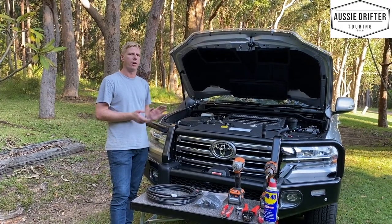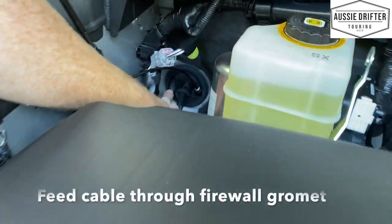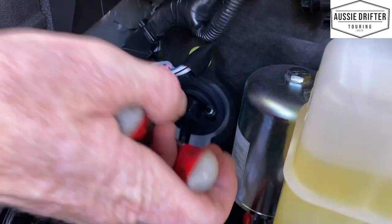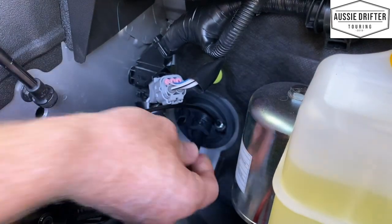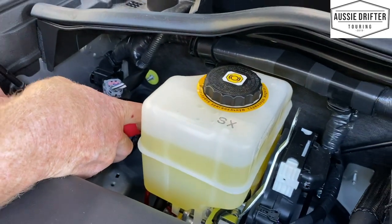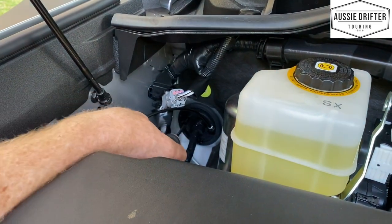We'll show you how to get the trims apart inside and run it all the way to the rear. Our first step requires a little bit of lubricant WD-40 and just a pair of side cutters. We're going to use this spare grommet — this is a main firewall grommet going through the driver's side and this is a spare nipple to run accessories through. What we do is just nip the end off that with a pair of side cutters. Once we've got the top off, we spray a little bit of WD-40 around that hole and also on the end of our cable, and then we just pierce it initially with a sharp tool like a screwdriver.